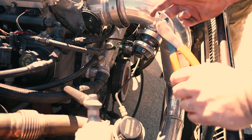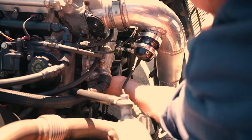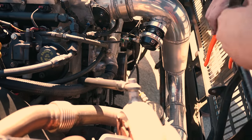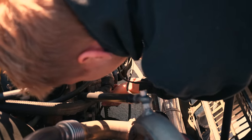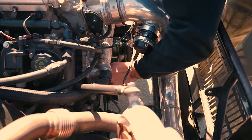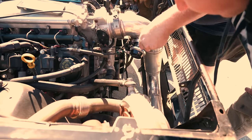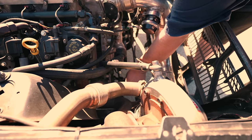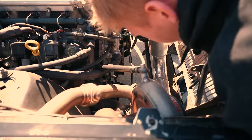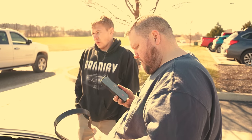I can snip it off. Snip what off? This. You see this piece of belt? Yeah. It's lodged. It won't give me any more. That's all it would give me when you were bumping it. If I take these snips and snip it off, we'll get it back to the shop, pull that belt off. Yeah, we should loosen that bottom pulley. Maybe. Let's get a wrench on that one. This didn't destroy the wires for the cam sensor.